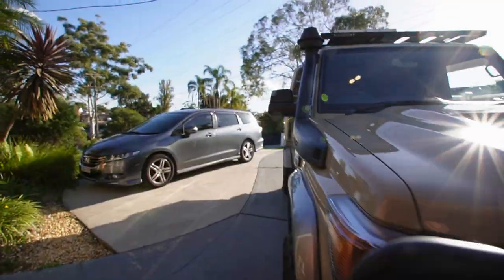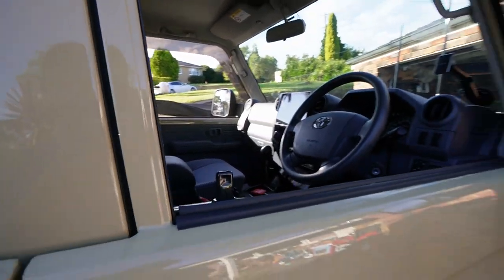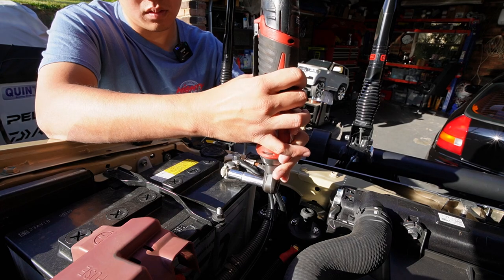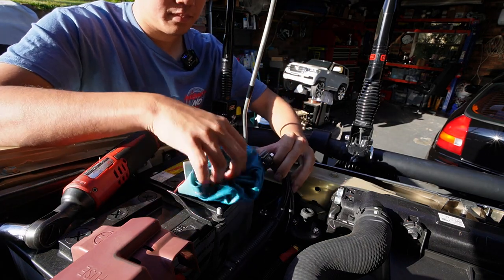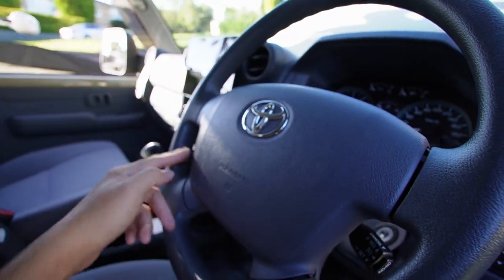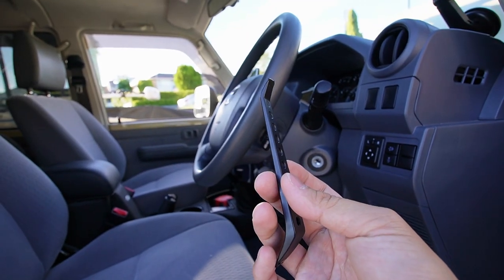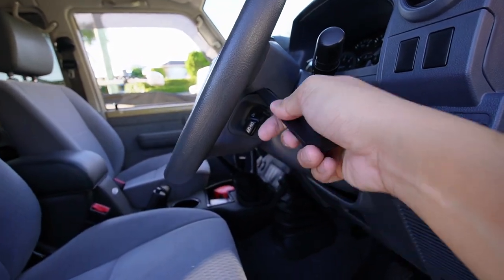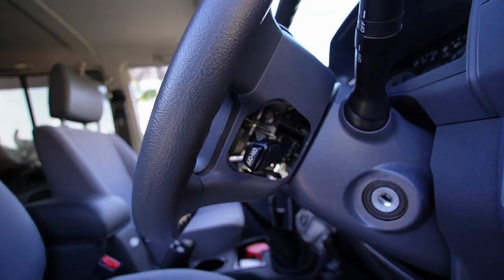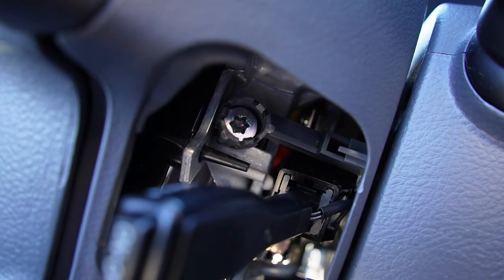Let's get into the installation. The first step is to remove the boss of the steering wheel, but most importantly, disconnect the battery. Next is to remove the horn pad — it's held in by two screws, one on each side of the steering wheel. To get to those two screws, we have to remove a cover on each side. Just with a plastic trim removal tool, we're going to gently pry the trim off. With the trim off, you can see there is a torx screw in there, and I'm going to be using a T27 bit.